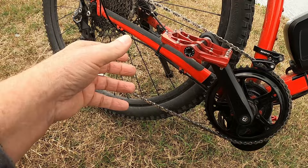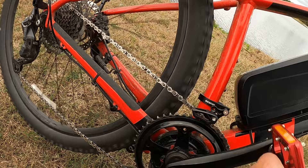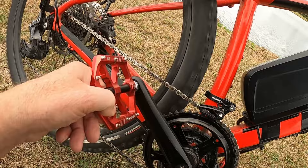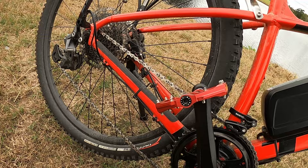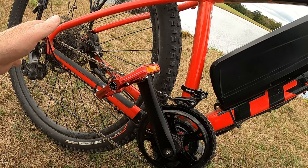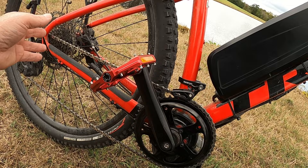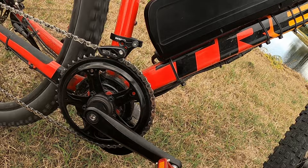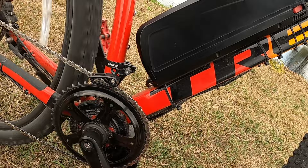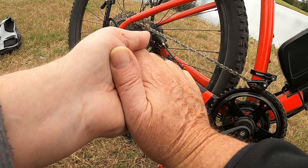Now as I shift into a higher gear - all the way into 10th gear - that's only 11 teeth. So 120, 130, 90 Newton meters - all of that is being dispersed over just 11 teeth, meaning maybe five or six teeth are absorbing all that power with that many fewer chain links. That is why you can break a chain on your mid-drive bike.